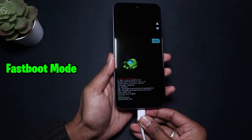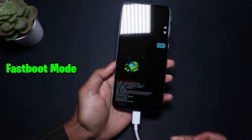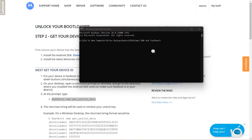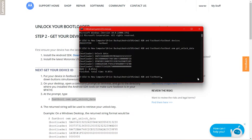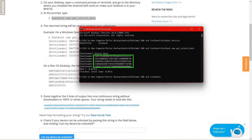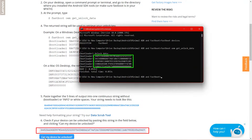Now connect the USB cable to your PC. You'll get a notification on your PC indicating that the device is detected. To test this, type 'fastboot devices' in the command prompt and hit Enter. If you see a device code appear, that confirms your phone is detected. You'll also see five lines of code on the Motorola website — you need to copy every single line and paste it as a single line, following the example shown on the page.